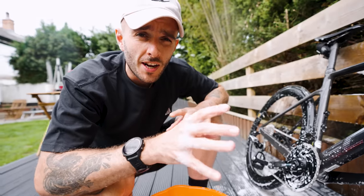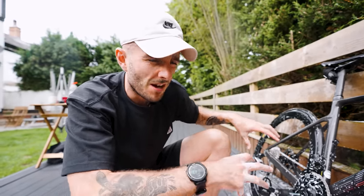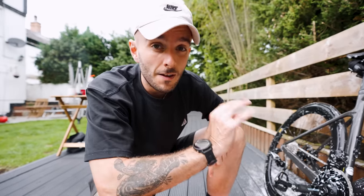You can really use some elbow grease here — you're not going to scratch anything, so go crazy on the chain if you want to make sure it's nice and shiny. If you're only going to clean one part of your bike, I'd recommend the drivetrain, because this is where all the moving parts that wear out are located. The frame will be nice and shiny, but the drivetrain is the bit that's going to save you money if you look after it.